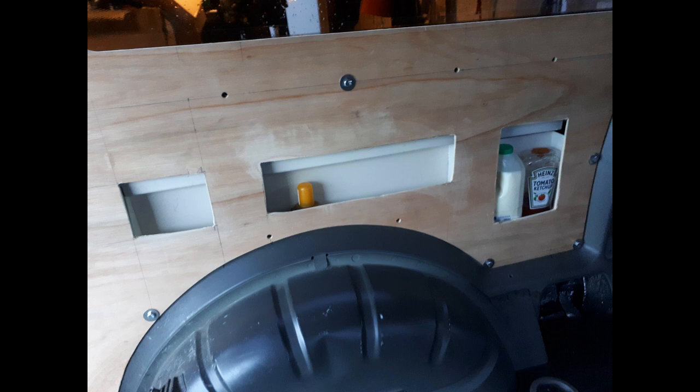I still have this sanding of the edges job to do. I know that I still need to square mine off, but I still have electrics to run behind this panel, so the panel isn't finished. But pretty much once you've got your nice neat squared off holes cut into the panel, that's the job done. You then finish the ply panel how you like, with carpet or paint or varnish. Now for me, after doing this, my next job is going to be boxing in the wheel arches so that I can fit a bed platform at wheel arch height.